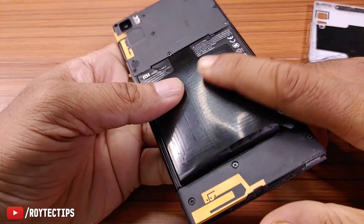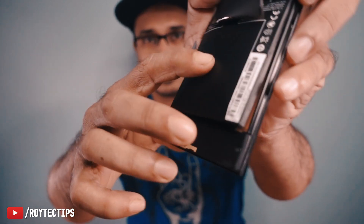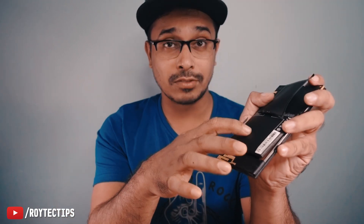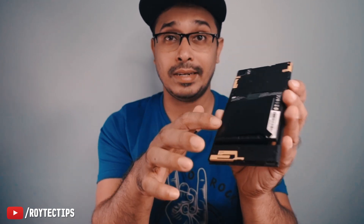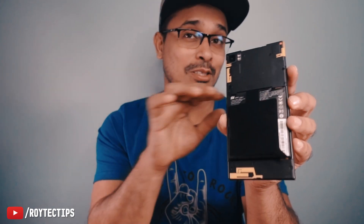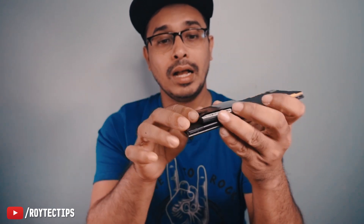Because of those chemical reactions, some gas forms inside the battery. The gas is not able to release outside and just gets trapped inside the battery. If you are able to remove the gas from the battery, the battery will fit perfectly. The problem is this battery is no longer available because it's such an old phone — I cannot buy a replacement battery anymore.